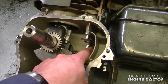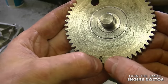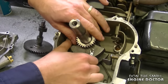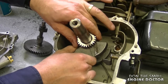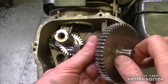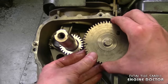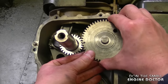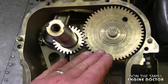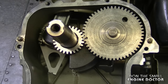I've also put a bit of oil where the camshaft will go. When you reinstall the camshaft you want to line up the timing mark on the crankshaft to the mark on the cam gear. To make it easier I'm going to turn the engine a bit so that the timing mark faces horizontally, and then when I put the camshaft in I just line up the two marks together — just like this, that's perfect. Sometimes you end up having to turn the crankshaft to line it up properly, but today it was a bit easier.